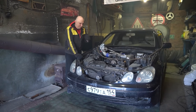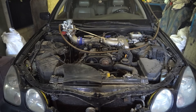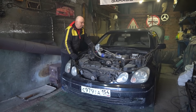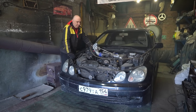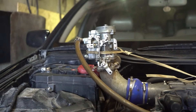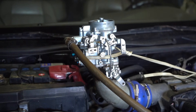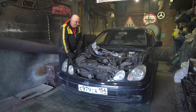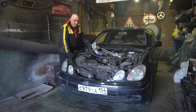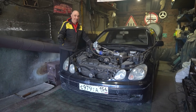After I completed the installation, I thought I'd successfully make it work, but no. The thing is, it doesn't start well in this position. I'm having to slightly close the butterfly valve for the engine to pull in more fuel. The engine runs at first, then it's unable to hold idle, and I'm forced to open the stock throttle body to maintain flow of air and fuel. Engine operation is very unstable — it keeps on stalling. Okay, I'm going to have to remove the factory throttle body. I wanted to keep this simple, but I'll stick the carby straight to the intake manifold. That should get this working for sure.